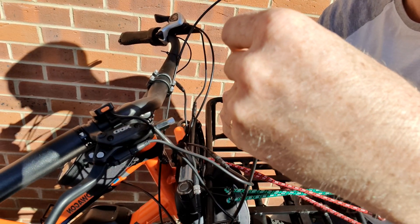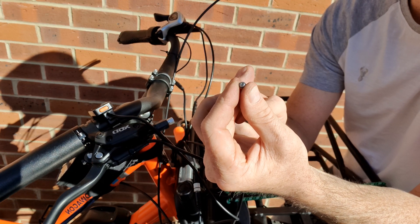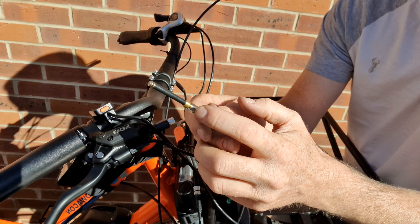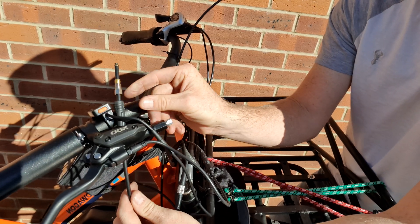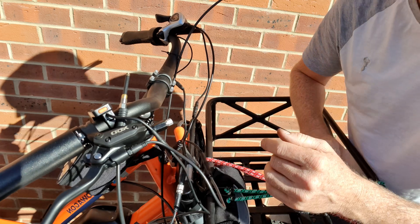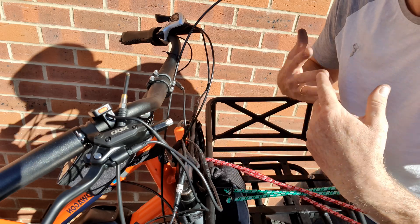Finally, we very carefully put on our copper seal. So: cover, bolt, copper seal. Let's secure that so the pipe is facing up — that's going to stop hydraulic fluid leaking out. I've tilted my bike so that this is facing up, which should also help prevent hydraulic fluid from coming out.